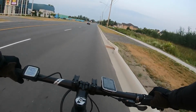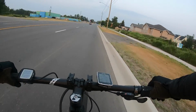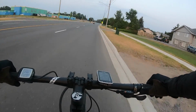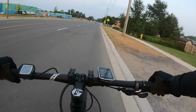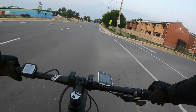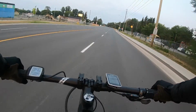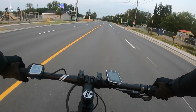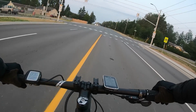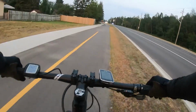So if you have an electric bike and you want it to go faster, just put on a little bit fatter tires, because it slows down the wheel rotation, and your bike thinks it's going slower than it is, so it will assist until it thinks it's going 32k an hour, but because you changed the tire size, it's actually going faster. And that works out great on an electric bike, because you have all that electric power to compensate for any additional weight or rolling resistance.